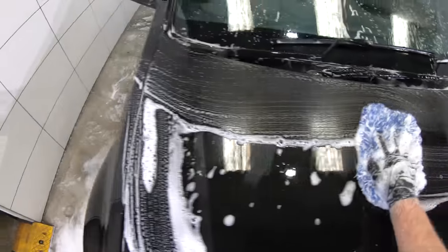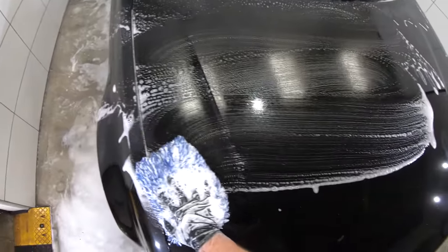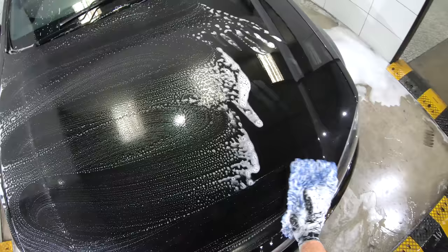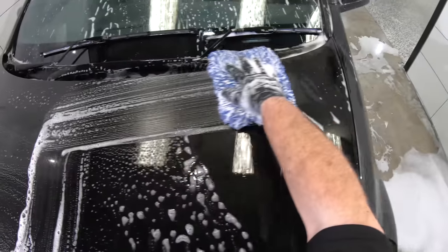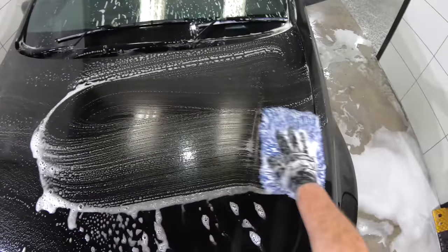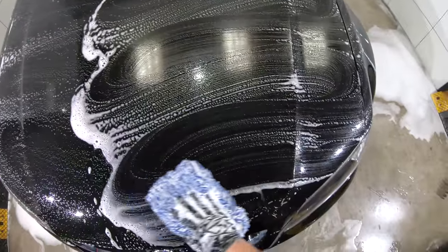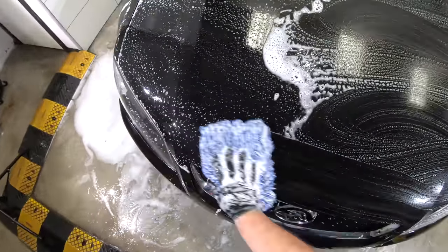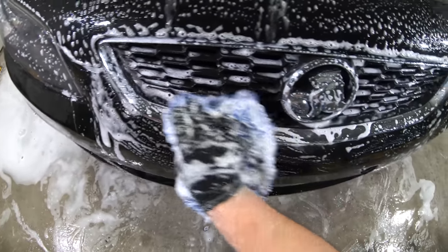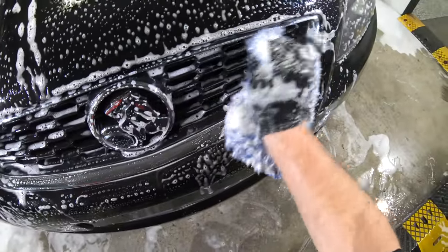A third safe car washing technique is the multi-wash pad method. In this method, you basically use lots of clean wash pads, each one just cleaning one section or two with a single soapy water bucket, and then set the wash pads aside after each use. The pros of this method is that you never reuse each side of the wash pad more than once, largely avoiding any chance of dirt contamination or swirls. You only need one wash bucket and there's no need to rinse the wash pads out as you'll generally wash them all together at the end, potentially in a washing machine cycle.